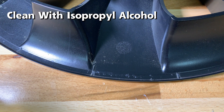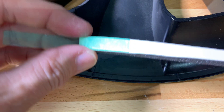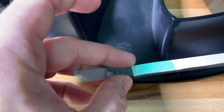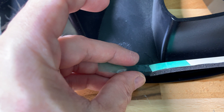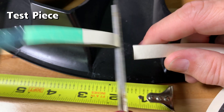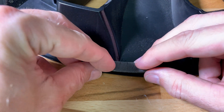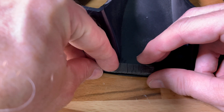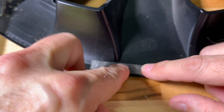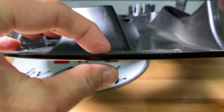The foam is sticky on one side with a backing plastic on the smooth side. First, I clean off the inside of the orbital aero cover edge with isopropyl alcohol — it's always a good idea to do this to maximize adhesion. I then cut off a 2-inch length of foam to do a test fit. I remove the protective plastic backing and stick it down along the outside of the cap, placing it just inside the edge, then press down to secure. This side view shows the thickness, which can be compressed when installed on the alloy wheel.